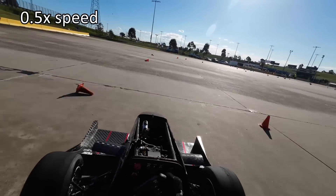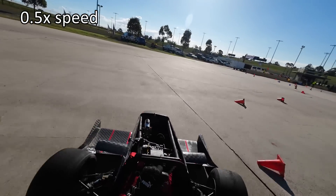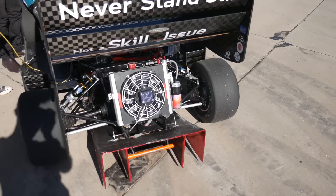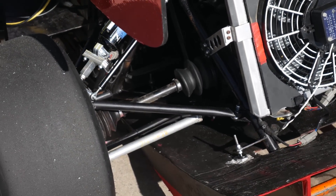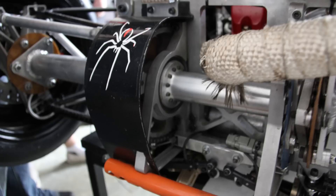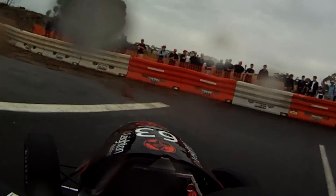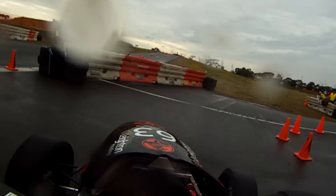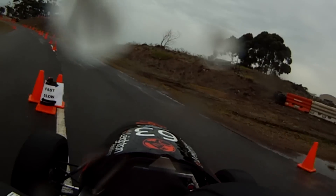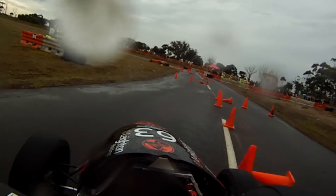In general it's just a very easy car to drive — anyone could hop in and set a pretty respectable lap time straight out of the box. One of the other features that's a big change from my old cars was that this one has a rear differential. Earlier SAE cars I used to drive had a locked spool rear end — no differential — which meant you generally had quite a lot of turn-in understeer and then it would rapidly switch to massive exit oversteer, snapping between different modes very quickly. This car was much more behaved and progressive in its general behavior.